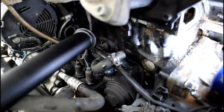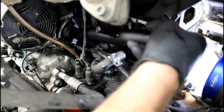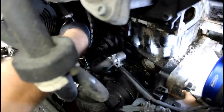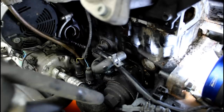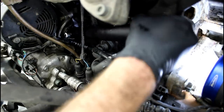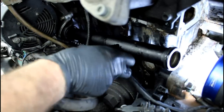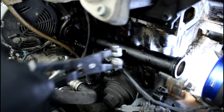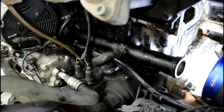Here we can see the port that the coolant pipe goes into — the water pump is just on the other side of that. I'm going to grab the pipe, lubricate the seal, and install the pipe first, going in the block end, installing it behind the wiring harness. Now that seal is going to be a little bit bigger than the factory one. Take a lot of care not to manhandle this pipe in — we don't want to roll or pinch the gasket and create a coolant leak. Got the pipe properly seated, going to put our coolant hose on and get our clamp put on.